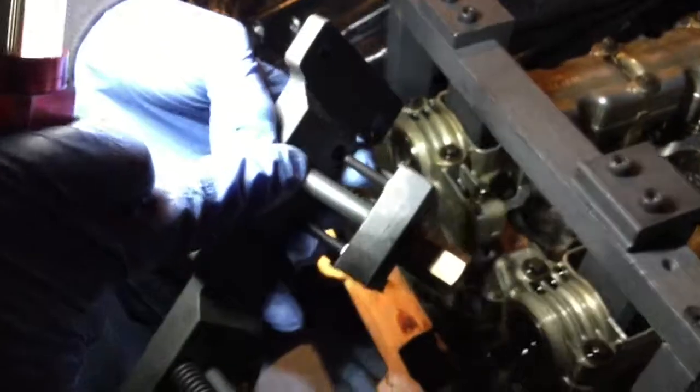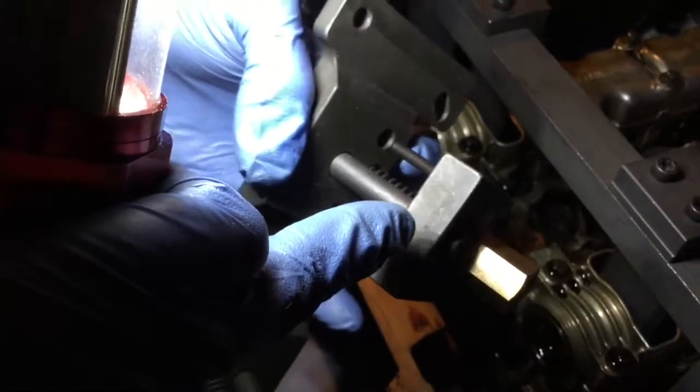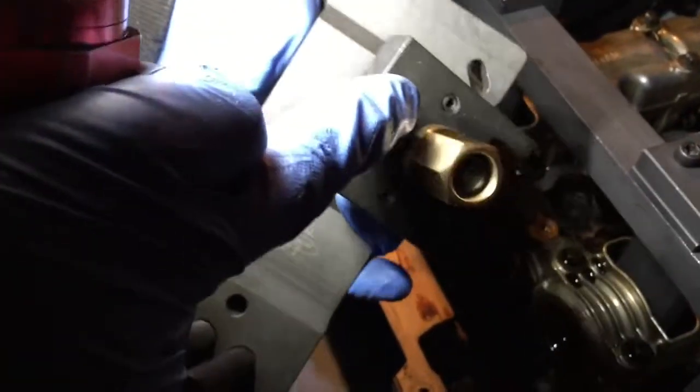Okay, these are stoppers here. These bolts are used as stoppers, so if it goes too far down, they prevent you from doing so. If ever it's a problem, we're going to have to slack those. These are set screws with an Allen key here and the lock nut here to squeeze against that surface.